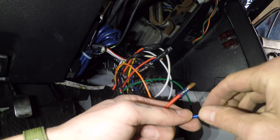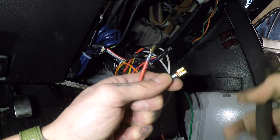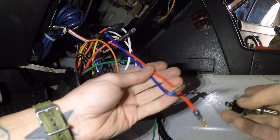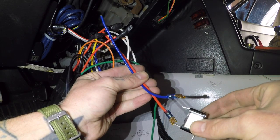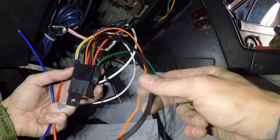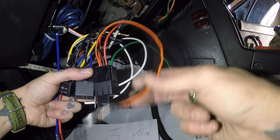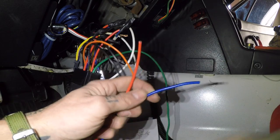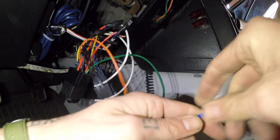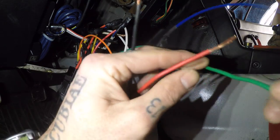Alternate the wire colors so it'll be easy to track which wire is doing what in case of a problem. As long as you double-check all your connections, make sure your crimps and twists are good, and your tape stays, you shouldn't really have any issues. These are going to go from the white wire to our two switches running the accessory and run relay, and the outputs go to the run relay and radio relay. We also need a wire to run to the start switch.